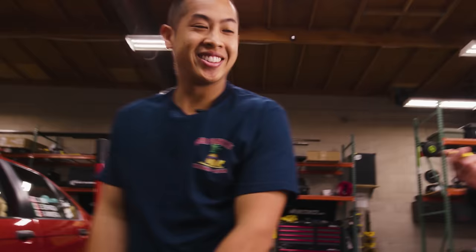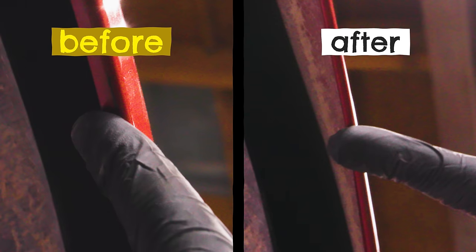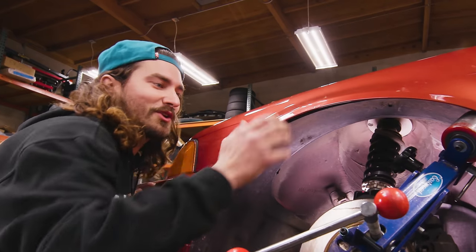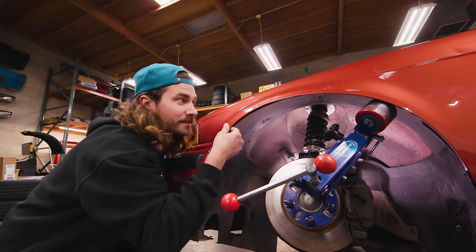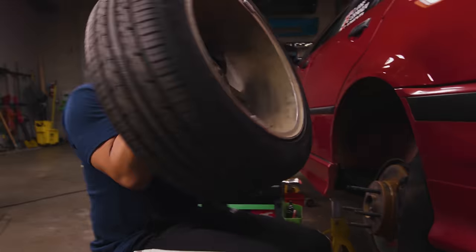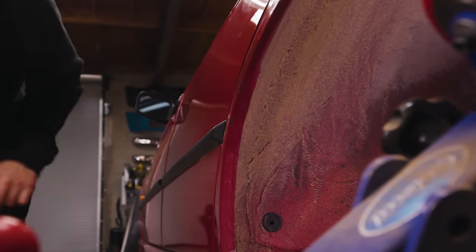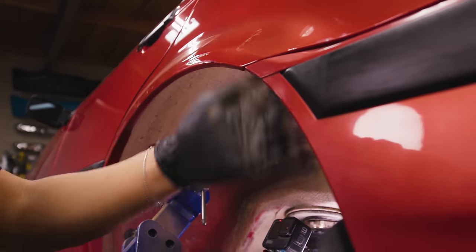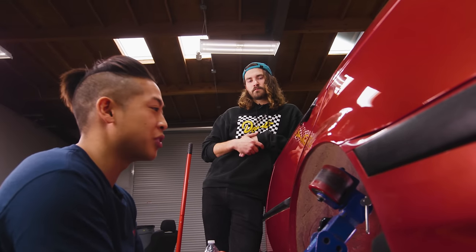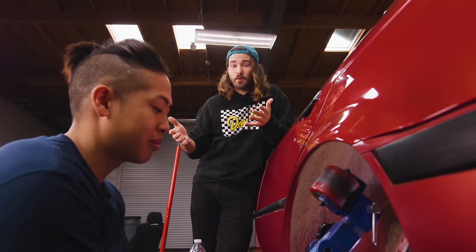Done. That took 14 minutes and 35 seconds for the front fender. That's a lot of clearance — looks a lot smoother. I think you did this thing a favor in terms of the overall fender shape. For the rears, just rolling the lip against the panel will give you the clearance you need. Sometimes you can shave the rears with a Dremel. The experience you have lets you know that — and I guess that's kind of what you pay for when you pay a pro to do this.